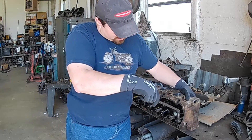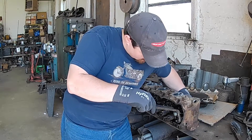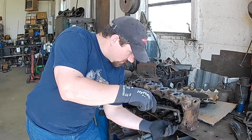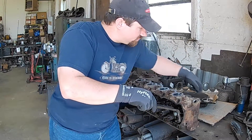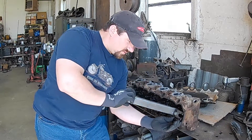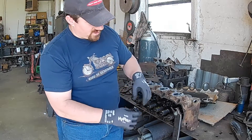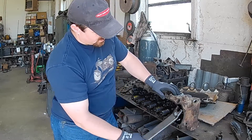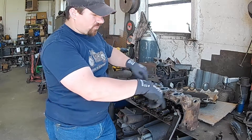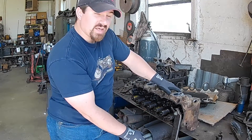Press down with this lever here and you'll just kind of pop the valve from the backside until it gets out where you can take the cups off of it, take those off, sit in there, and release the spring. That's how a valve spring removal tool works. We're going to take out the rest of these and then I'm going to flip it around and we're going to do some valve lapping — I'll explain that to you guys and show you what that is.